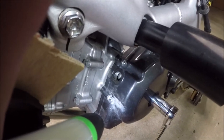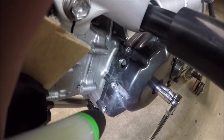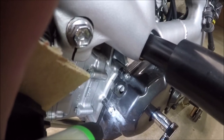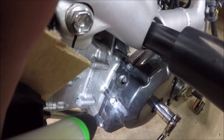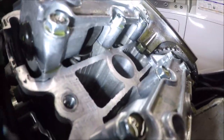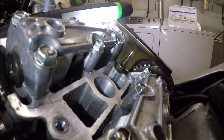They're not pointing up and inward. So I need to go 360 degrees on this so that I can get the R again. The F is going to be 90 degrees behind it. So that's one quarter, two quarters, three quarters. Now I've got to go slower and find the R. There's my R. Now I can see the cam lobes are pointing up and in, which means I'm going to be able to get my feeler gauge underneath and check these clearances.